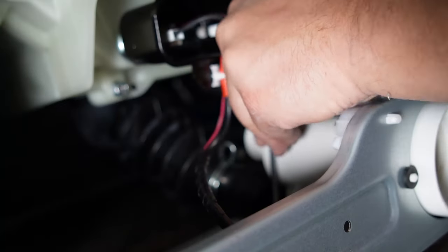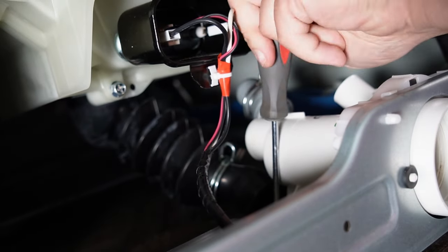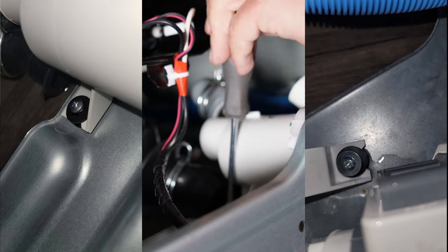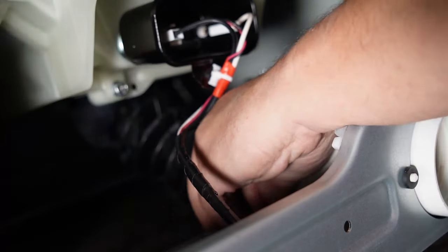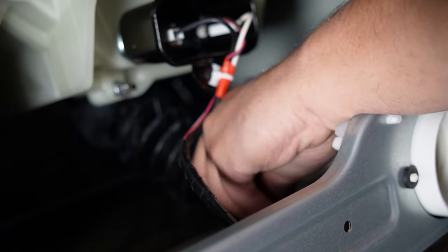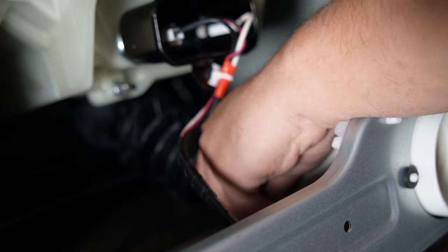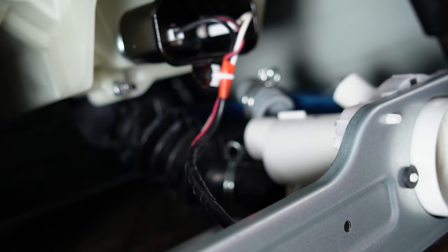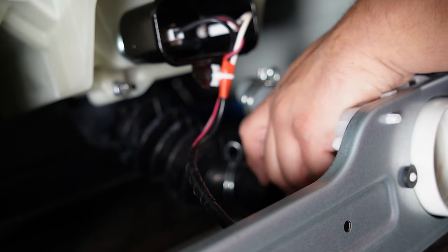With the hoses separated, there are two screws that hold the pump on the bottom of the washer from the top. You will need a short screwdriver to remove these screws from the housing, and you either should have an inspection mirror or use your fingers really well to feel for the screw heads and gently remove them. I didn't find this as hard as reinstalling them though, honestly. Once the screws are out, you can remove the pump from the housing.